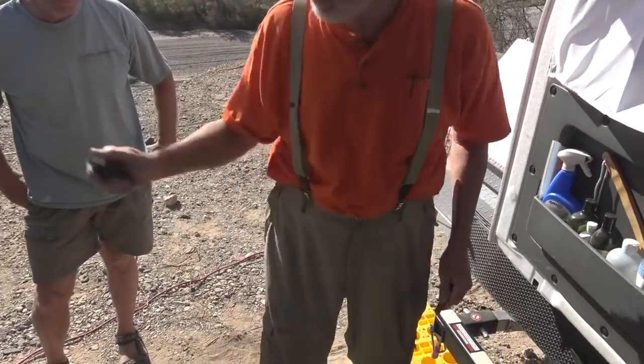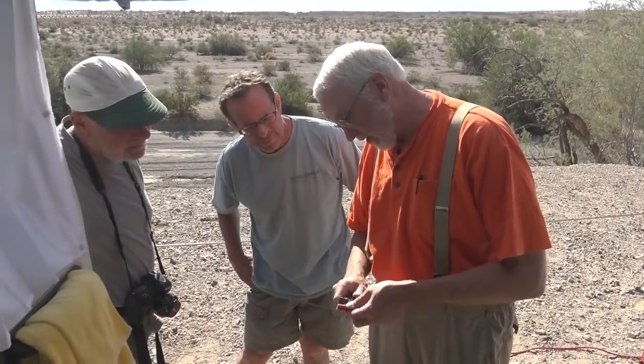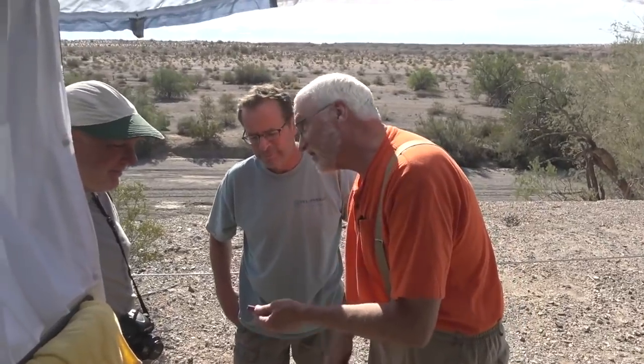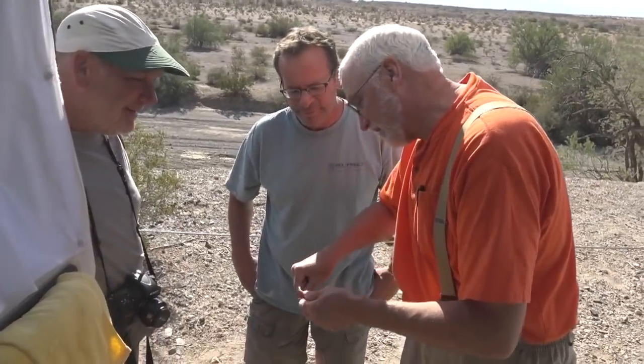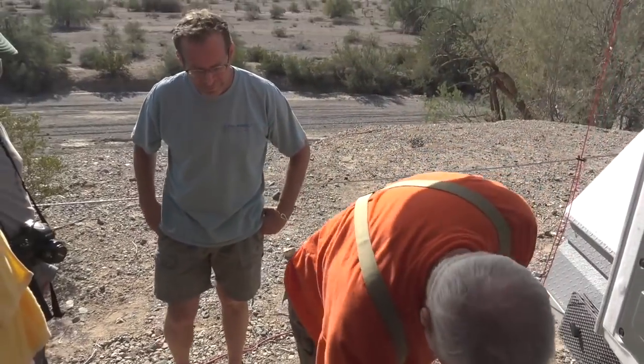What's in there — a little blade — what is it that's doing the cutting? It's a blade. What you do is cut it around, and then when you take it off, you flip it at 90 degrees and it cuts that little side cut, so when you grab it, that's what comes apart and it just peels right off. Nice. And you know that none of those conductors have been cut, because the paper's still there. You set the insulation depth by screwing this up or down, exposing more or less blade, so you set it for the insulation you're using and you only cut the insulation and not anything else.